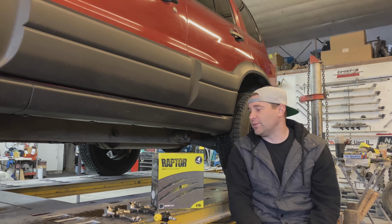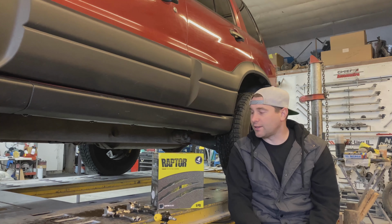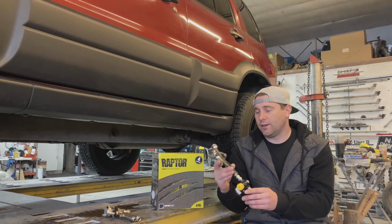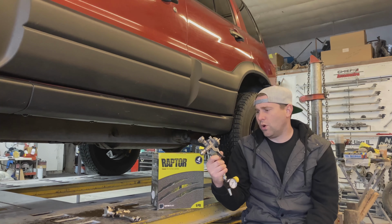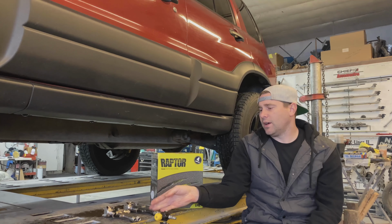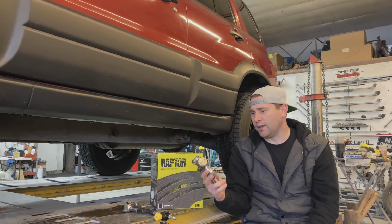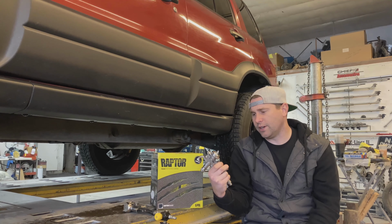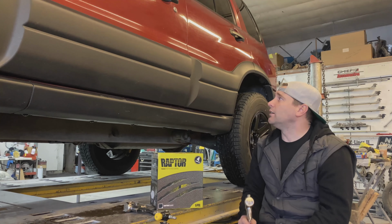All right, so the products I used to do the job were U-POL's Raptor liner. We used black, obviously. We used the Ducks guns to spray. The sealer was with the original gravity feed Ducks gun, and I believe I have a 1.4 on this with an A1 air cap, and I used the Ducks platinum pressure feed to do the Raptor, and I had a 1.2 on this self-cleaning needle and A1 air cap when I did it, and I was really happy the way it laid out.